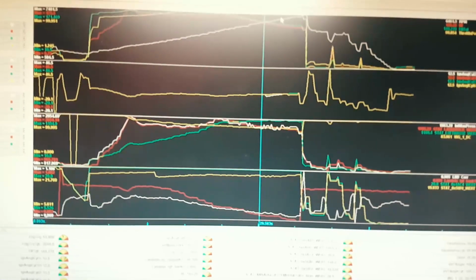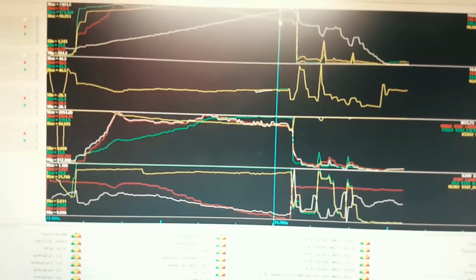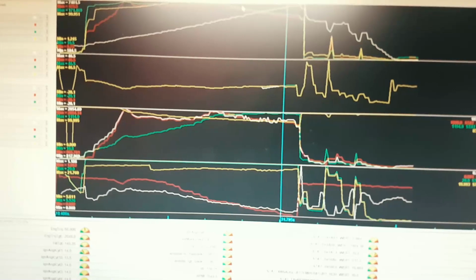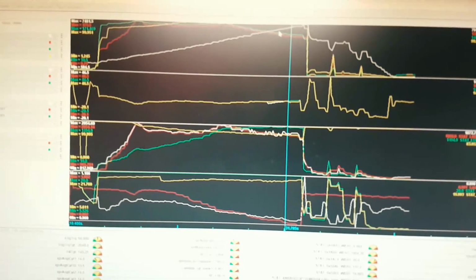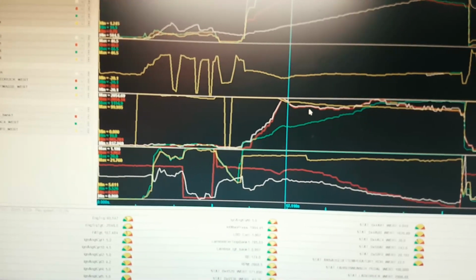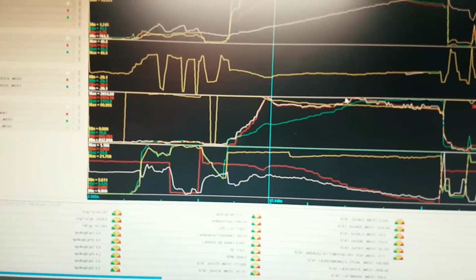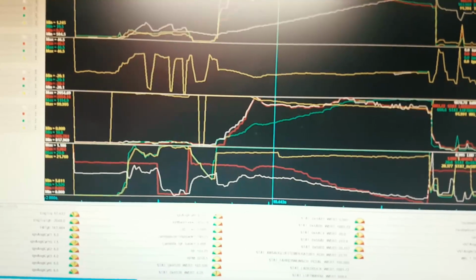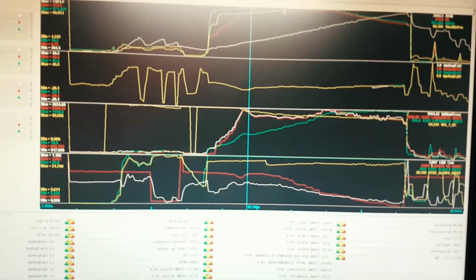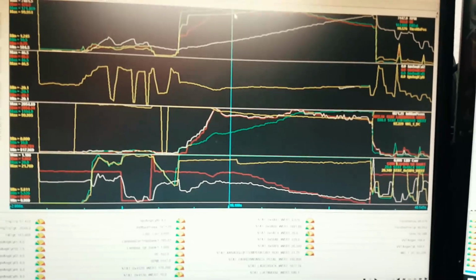It then drops off to about 140 at about 7,000 RPM, and these cars make peak power between 6,500 and 7,000 RPM, and slightly less sometimes as well. The reason for that is it targets 1 bar of boost pressure constantly, but it requires a set amount of load to fulfill that. So lower down in the rev range, where the wastegate duty cycle is going to be higher to spool up, it literally closes the throttle body to compensate for any overboost within the ECU.